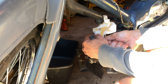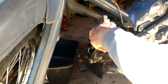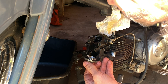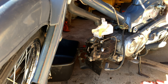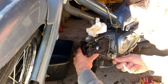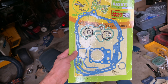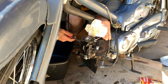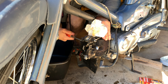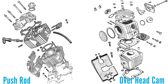This is where you check valve clearance, and I'll be doing that — I could probably do that in another video. For now I'm just breaking the caps because it's easier to do. There's a gasket between the cover and the head and it's getting replaced along with a lot of other gaskets and rubbers. The kits all come from Thailand, so just stab into that gasket with a thin flathead and show no mercy.